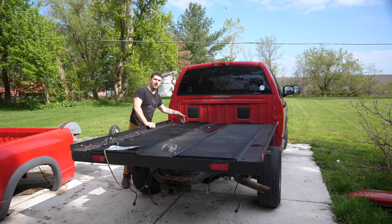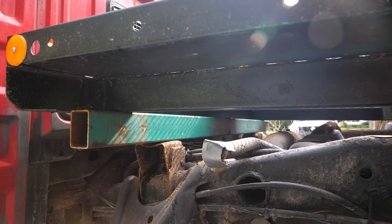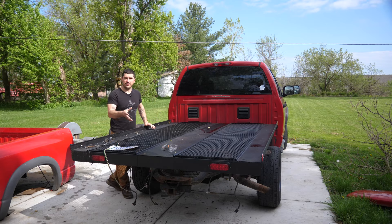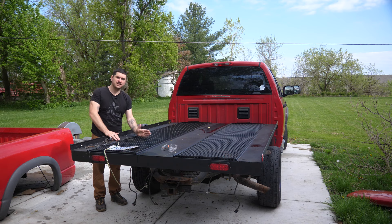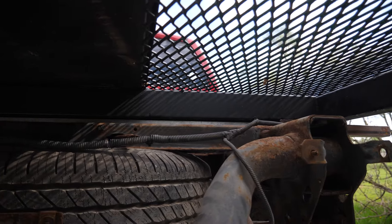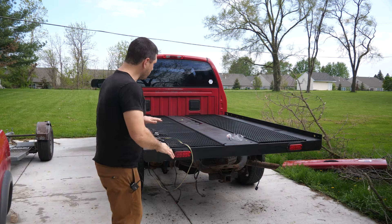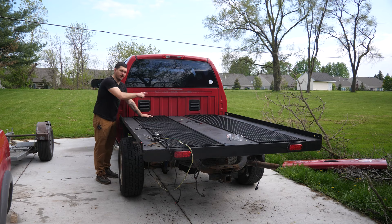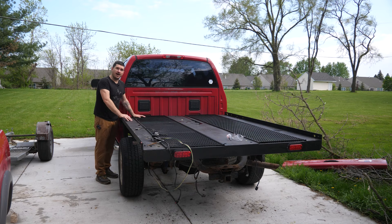We mocked it up — lifted it, set it down, and have it right where we want it. For the front, we're going to be able to use the front mounts where the two front bolts went in — the ones that were rotted out on this truck. I took that original support bar and set it vertically, then set the trailer on top of that. I'm actually going to bolt it in because the idea is I want to make this removable with relative ease — I don't want to weld everything to the truck in case I need to access the fuel pump or get underneath for the shocks. In the rear they don't line up with any of the existing mounts, but I have a one-and-a-quarter-inch square tube that goes all the way across to level it and raise it above the spring mounts.